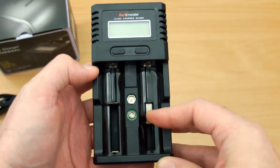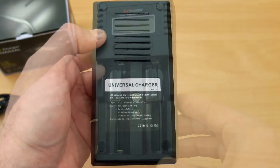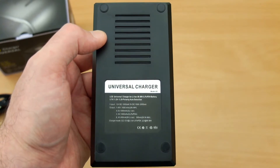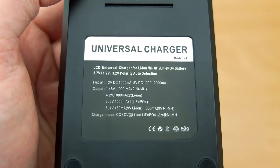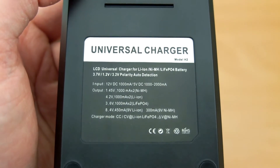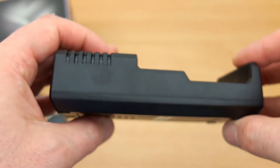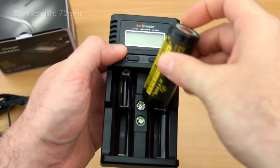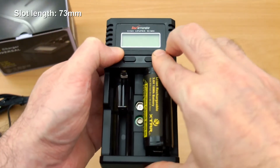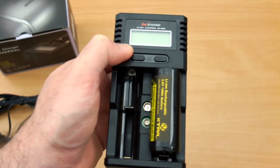Taking a look at the charger, it's a standard size for this type of charger. We also note the nine-volt charging in the middle. On the back we have four silicone pads and some ventilation. The power input and mini USB port are located on the side. In terms of build quality it's pretty good — the sliders feel decent and quite smooth. I've been testing different cells including protected cells and there are no problems at all; the slots are a fairly good length at about 73 millimeters.